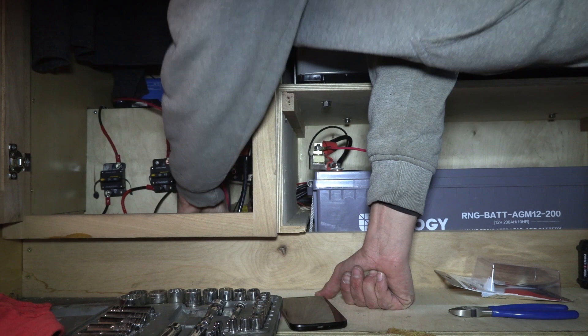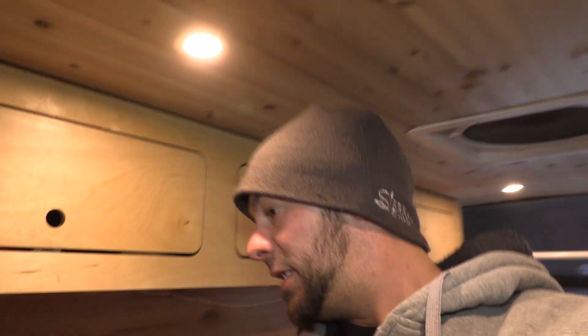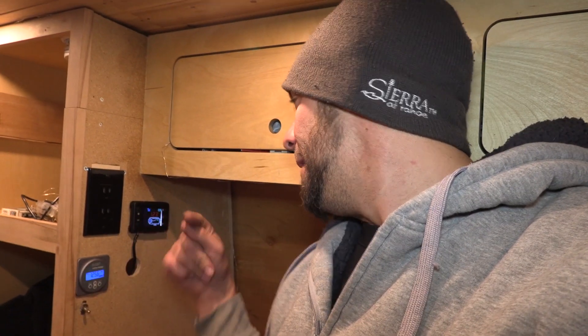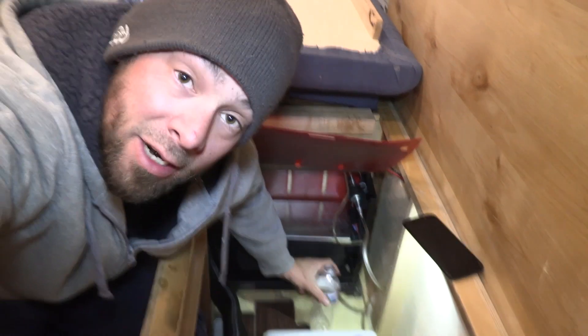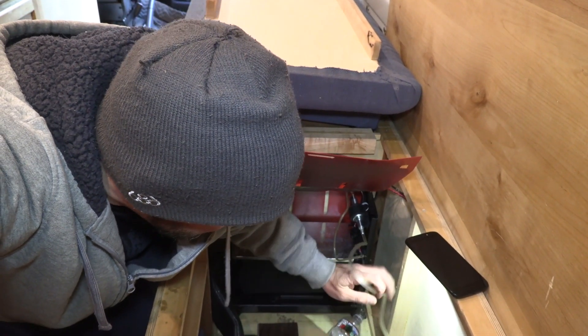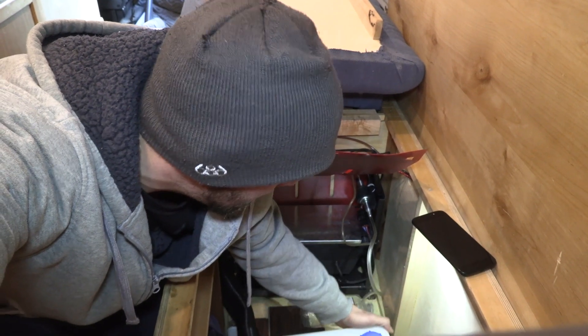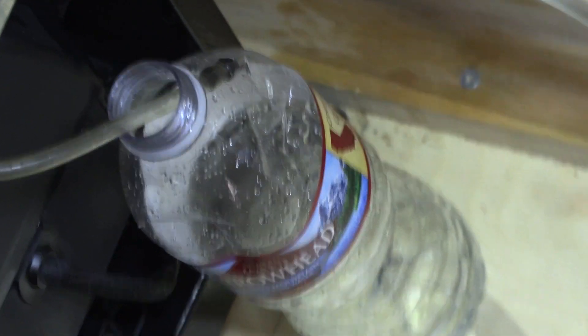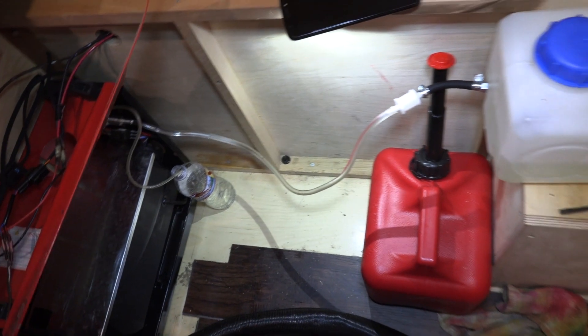Turn the lights back on. Now that I'm plugged in directly to the battery, one thing that we have to check is on the little screen — we're still getting 12.3 volts right now just connected directly to the battery. Before when it was connected to the bus bar negative, it was only getting to 10 volts while it was working. Now we're not gonna pump into the engine — we're just gonna burn off all the excess gas. We've got our inline filter set up the correct direction and we're gonna pump into a water bottle for the excess gas.